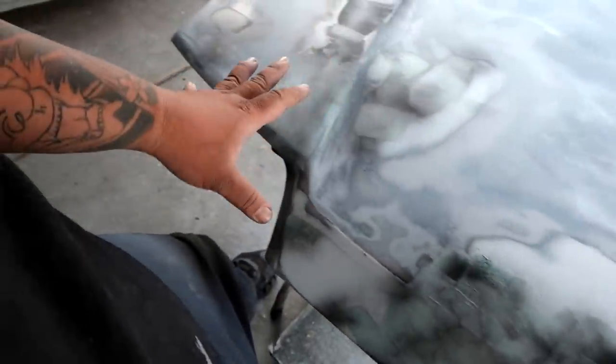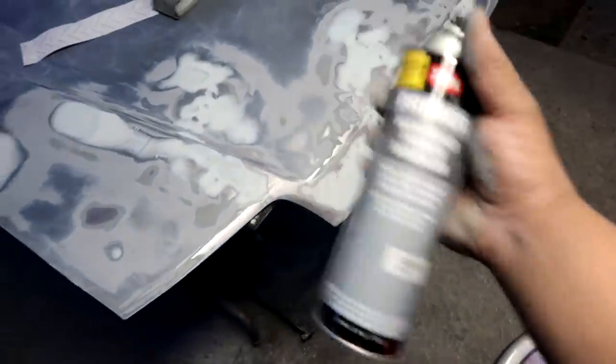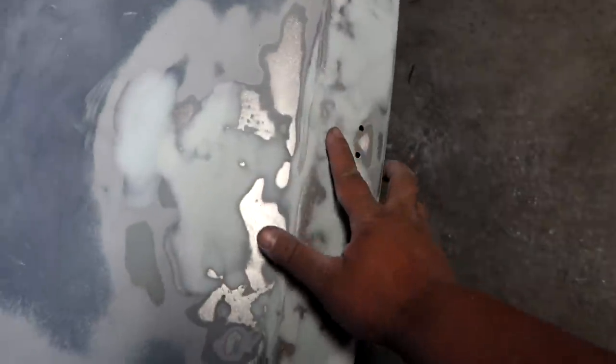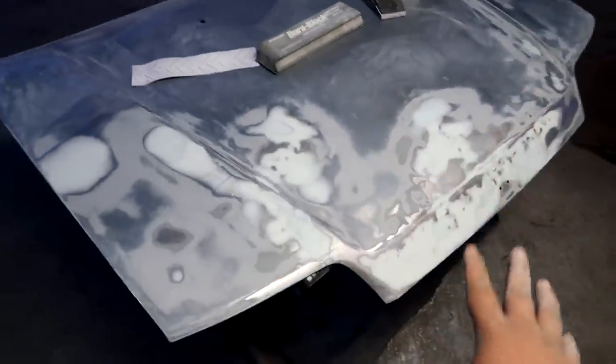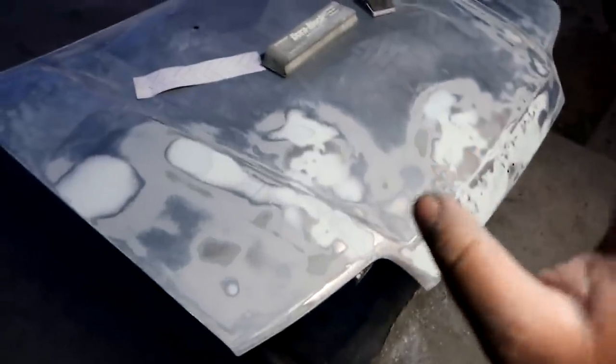I am looking at this hood and it is looking a ton better than when we first started. I applied a little bit of glaze on the areas I didn't have to touch and I'm still going to use a DA sander. This is already dried — I'm just letting the guide coat dry before final sanding. I had to finish this by hand because my brother's sleeping so I put the compressor away, and it's ready for primer. There's still a little low spot and some small high spots, but I'm not worried about it — this is just a test hood to see if I still got it.